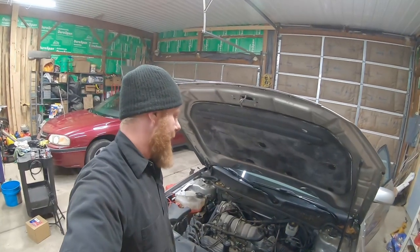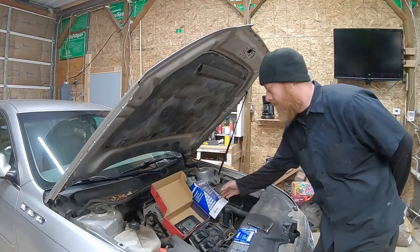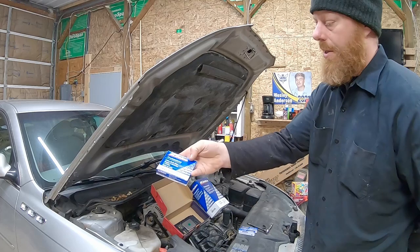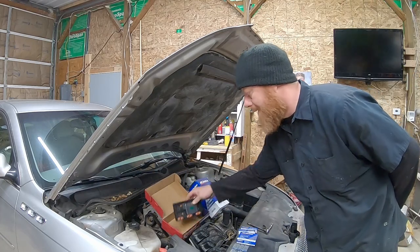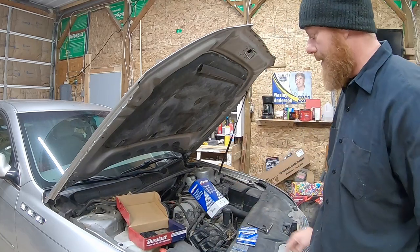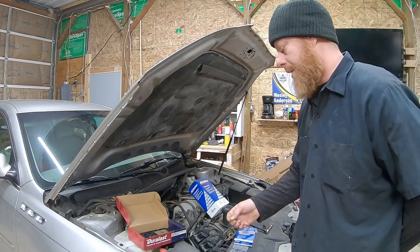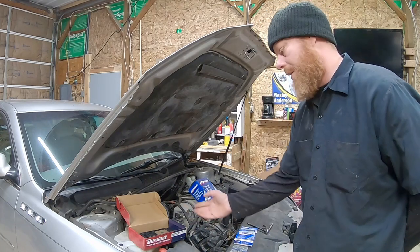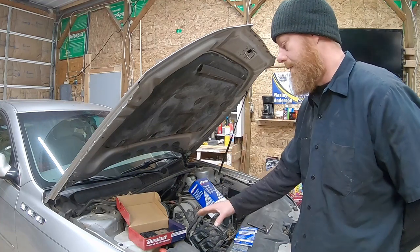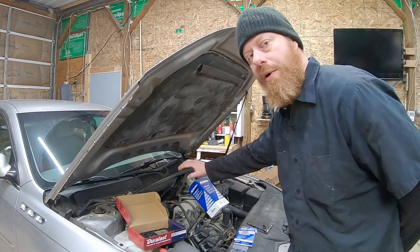It's a really expensive part, so I wanted to be absolutely sure before I called one out here. We got our parts: ACDelco plug wires, ACDelco Iridium plugs, and a Duralast ignition control module. Some people might ask why ACDelco plug wires and a Duralast ignition module — my answer is the warranty. It's going to have a lifetime warranty. This lady comes to us when she has an issue, so we're going to go for the warranty on this one. We'll start removing the rear plugs first because they're more difficult than the front plugs.